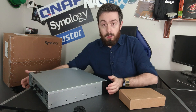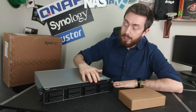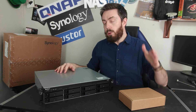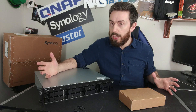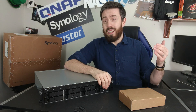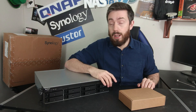This device is currently available pretty much worldwide, and this is not the last Ryzen rack mount we're going to see. We have already heard about the RS2421 Plus — already talked about on NAS Compares — so there is going to be a bigger variant of this. If you are looking for more storage off the bat, that 12-bay device can be expanded by another 12 bays, instantly removing that as any kind of barrier. Yes, you have to power a bit more, but you are talking about a lot more storage and bang for your buck. A number of businesses that look at rack mount solutions like this are thinking about longevity of their storage. It does arrive with support of SHR — Synology Hybrid RAID — something that generally on rack mount devices you just don't find. SHR with its fluidity in RAID configurations is just something that isn't in traditional RAID, which gives you RAID 1, RAID 5, RAID 6, etc. — admittedly with a bit more performance — but I think a lot of people like the fluidity of storage in SHR, and it's nice that a rack mount like this has it.